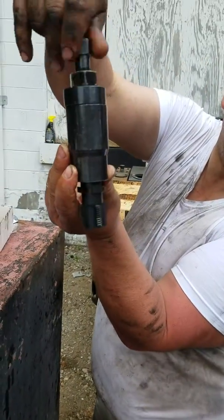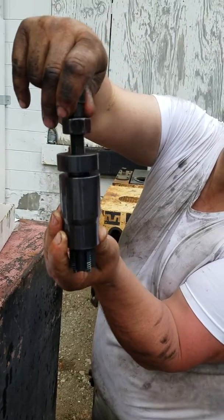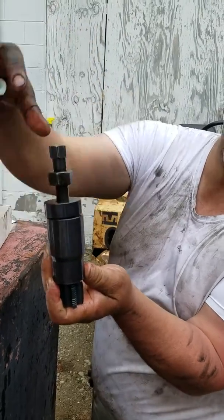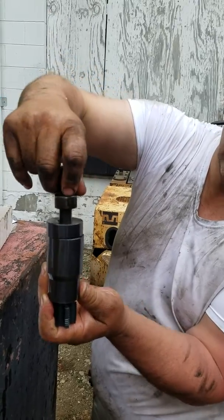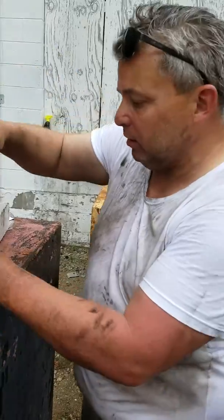It comes in this box with the O-rings and the six sleeves. This screws down into your old sleeve — screw it right down nice and tight. That'll set like that, and then you get a bigger one over the top, screw that down, and then that'll push this down and pull your sleeve right out.